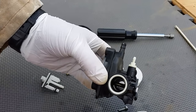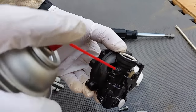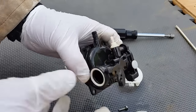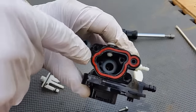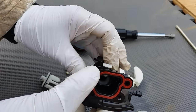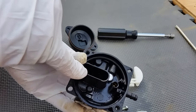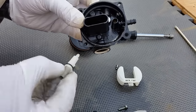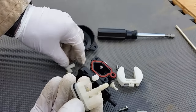Make sure everything's not gunked up and get the outside real good. Everything's working now. There's only one trick to getting this back together, and that is the inner piece — there's a white piece down here. If you don't push that in and get it back set into position, it won't give you a hole here to place your center shaft into. The only other question is getting this back together.